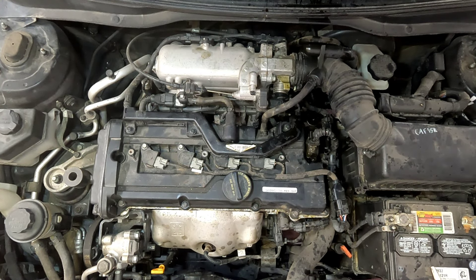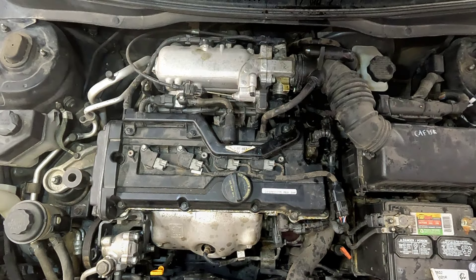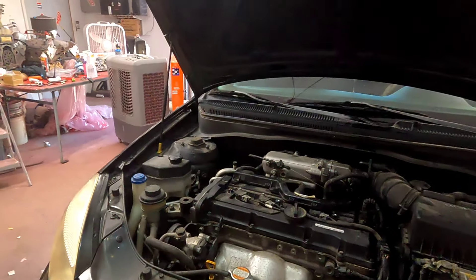Not sure what's going on — it's not knocking, but it does not want to run. It smells like the catalytic converter might be plugged up. That was weird. Now it's running really good, and all I did was unhook the battery — touch positive and negative together — and that clears the computer. Apparently that did it, because she's running good now.